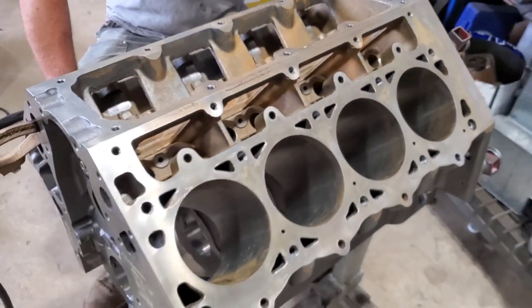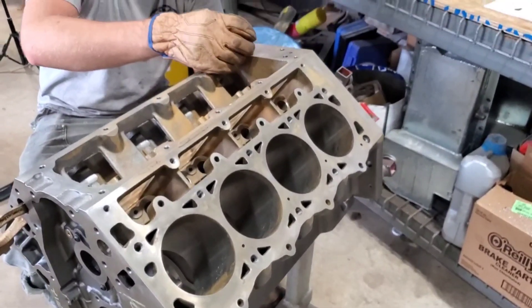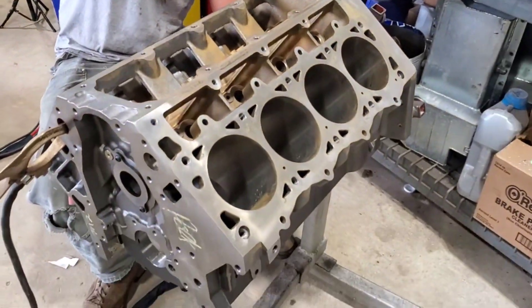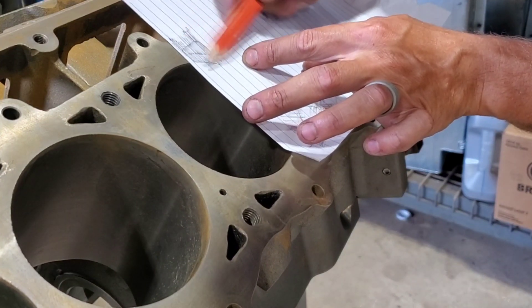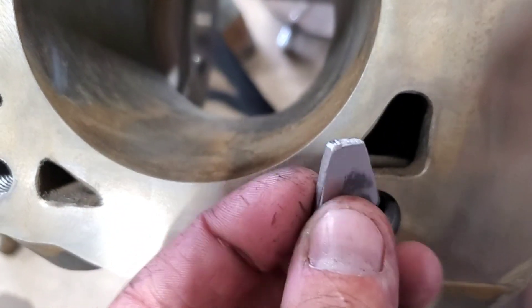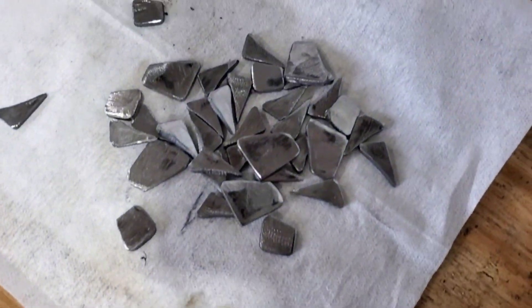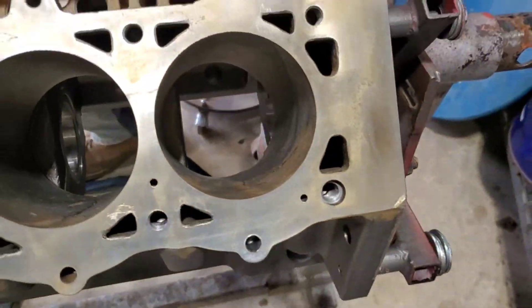What we're going to do is weld little pieces of metal that we traced out — just little pieces like that right there. We traced those out on a little piece of paper and took them to a friend of ours, and he cut them out on a CNC plasma cutter. This is kind of how they turned out — just a bunch of little pieces that fit exactly in the water jacket hole. We spent a lot of time cleaning those up, getting all the slag off and getting all the junk out of this block.